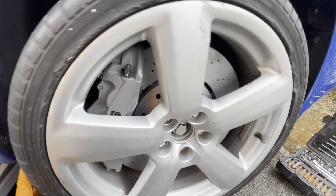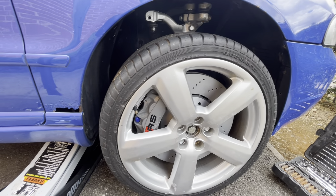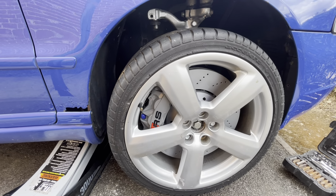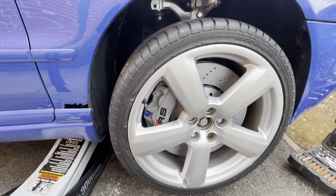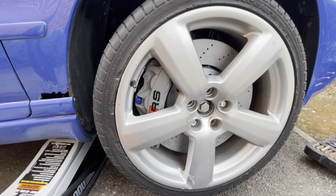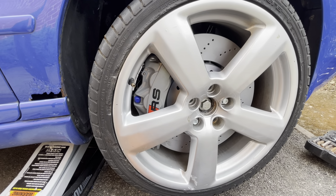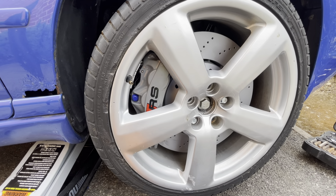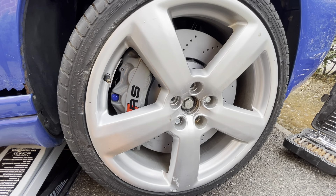The only thing I've got left to do is fit a new brake hose, because the S4 one is too short — it doesn't reach after taking into consideration full lock. I've got a 375 millimeter brake hose coming, though I don't think that's going to be enough to be honest. If it doesn't work I'll have to go back online and source something else.